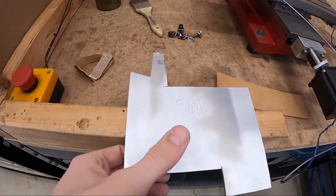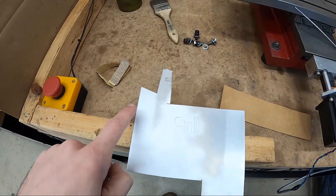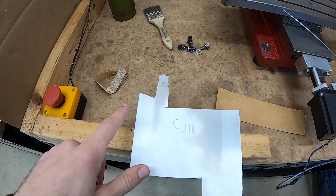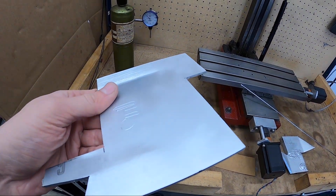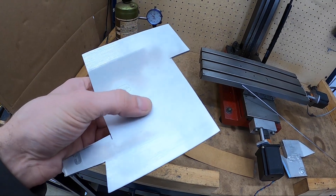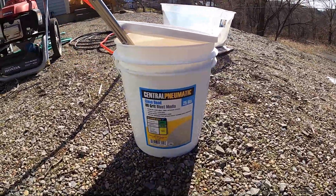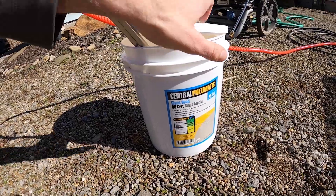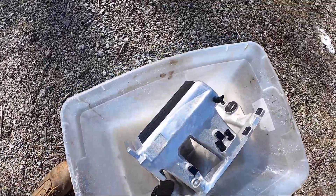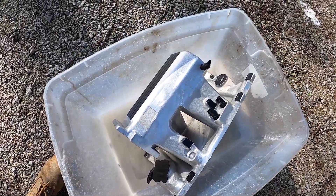I did another round of testing and it turned out okay, but I think I'm going to have to go up in grit size — more coarse grit. I sanded it with three different grits of sandpaper just to see how much I'd have to sand the manifold down. Even with 120 grit sanding, you can still very finely see the scratches. So last minute I decided to run to Harbor Freight and got the last bag of 80 grit blast media. I taped up all the spots I don't want to media blast and let's just do it and see how it looks.